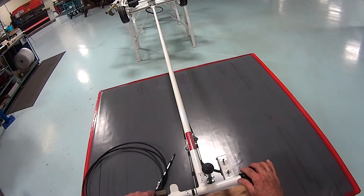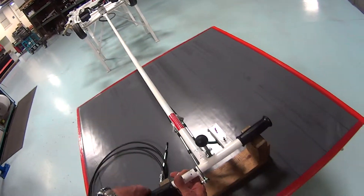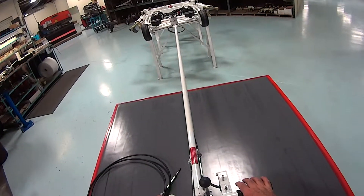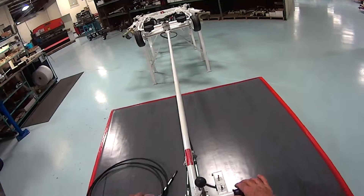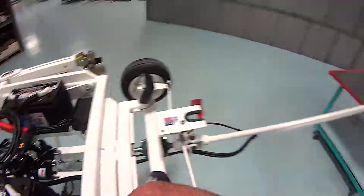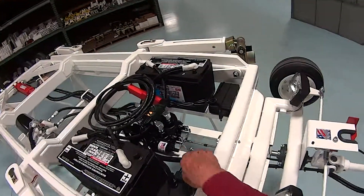It's not pushing the valve lever far enough forward. We don't want this nut making contact here prior to the valve hitting the stop on the valve body. Once you've gotten it adjusted, put it on the ground and operate it without an aircraft on to ensure everything functions properly. If you put it in this position and run the hydraulic motor and the wheel turns, you don't have it adjusted properly — you're not going far enough into the detent, not pushing the lever far enough at this location. It's all adjusted through the two nuts on that end. You can see the neutral position.